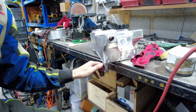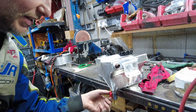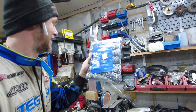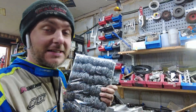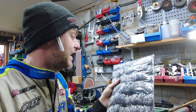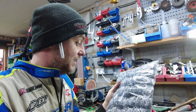We have a drain. Some people run it back into the sump — I don't like that idea. I'd rather it collect and then I can drain it, just put a hose and drain it. Also, this thing is going to be filled with this — a marvel of Chinese engineering: stainless steel scourers. I've used them before and they work really well. So instead of doing baffles inside the tank, you basically fill it fully with this material and it acts as a baffle. I read it on the internet, so it has to be true, right?